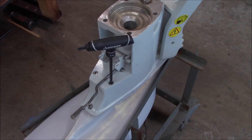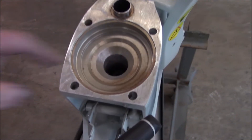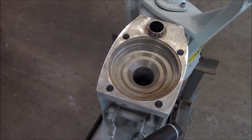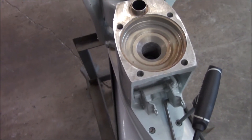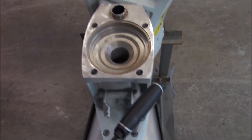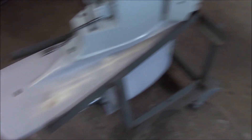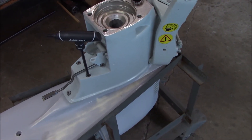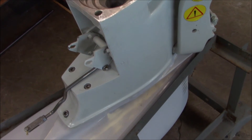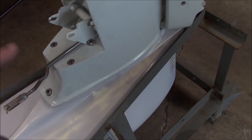For the smaller bolts, a quarter-inch T-handle is perfect — just wrist-power tightening is all you need. You can put a torque wrench on for 10 foot-pounds if you want, but getting a torque wrench on these is a challenge. One note: the shaft that comes up through the lower unit comes in two different lengths — if you have a short shaft model, which is fairly rare, there's a longer coupling for those. Also, use a crisscross pattern when tightening, and don't do it all at once — work your way around gradually, back and forth.